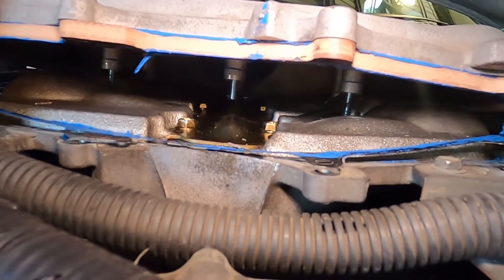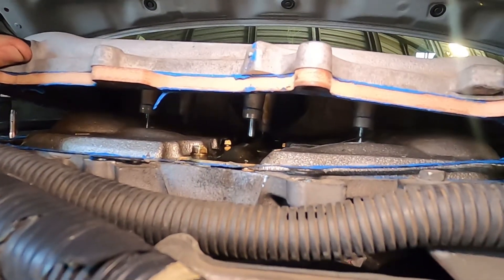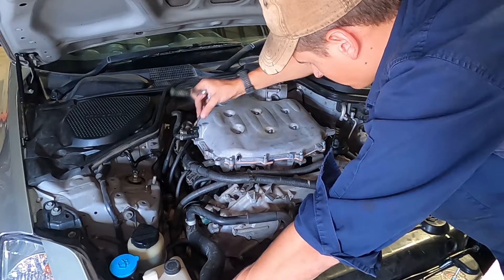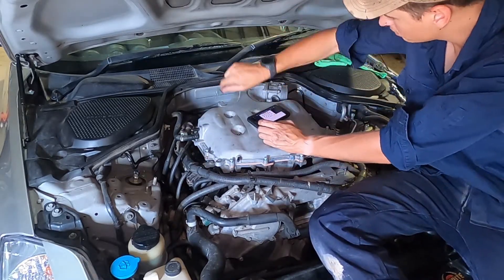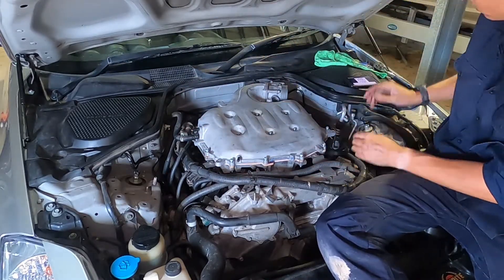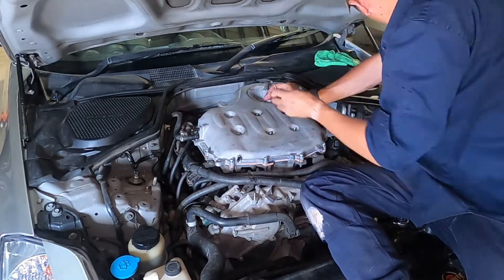The gasket maker actually helps to stick those spacer rings on. You can see on the inside I've got all those spacers in there. I cracked open the plenum to make sure each one was attached and wasn't floating around loose — the last thing you'd want is to suck one of these in. So just make sure you can see them all sticking on the bolts and not floating around inside. Here's the torque pattern I went around in, so if you need that, pause it there. I'm just taking out two studs at the front and then going around following that pattern. I didn't end up torquing to spec — I just did it hand tight. But do be careful when tightening these; it's only aluminium so it's really easy to strip them. That's not something you want to do with your air intake, so just make sure you don't overdo it.